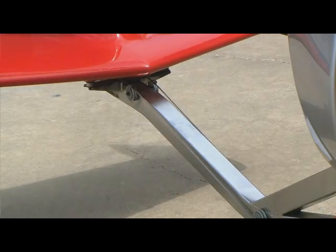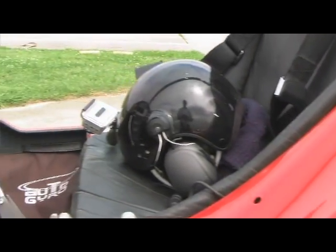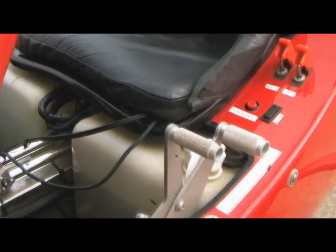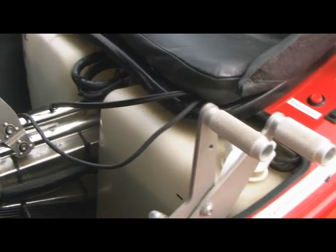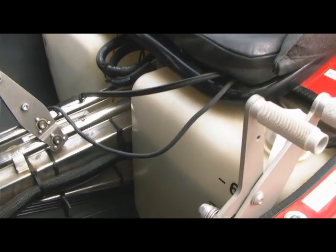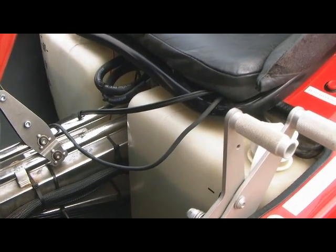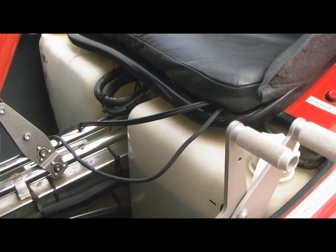This is to help all controlling surfaces assure free and clear. This is to provide a little bit more visual inspection. Also, I failed to check that we want to darn well make sure we got gas in here. As you can see, it's moving up right here by my fingertip. Shows the fuel level. That's enough for about 2.5 hours of time. We're only going to be going for a little while, so it shouldn't be a problem.